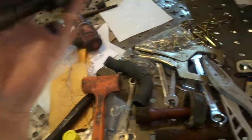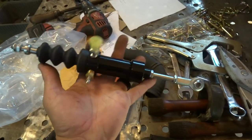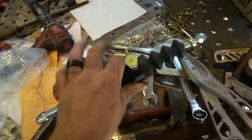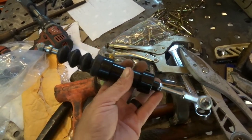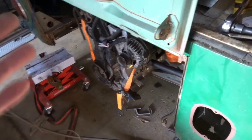This is what's going to be operating the transmission. Instead of cable operated, I went with a hydraulic actuated slave cylinder. And there's a hydraulic master cylinder around here to run it. Gets rid of all the cables. I think this is a better option than running the cable back - especially because the position of the transmission changed, so clutch cable sizing might be a bit of a conundrum. I don't know if there are going to be different lengths or what.